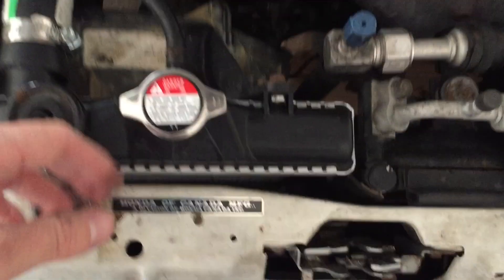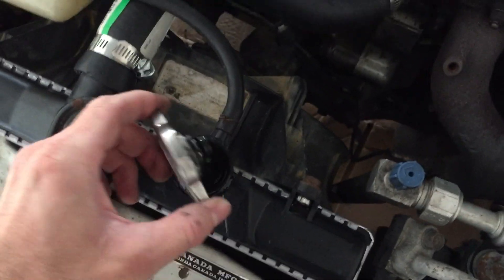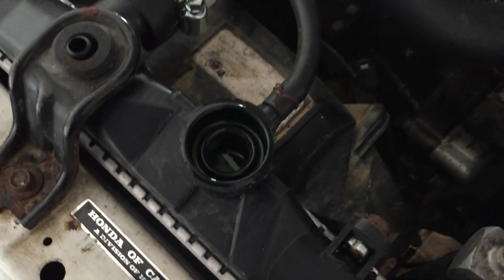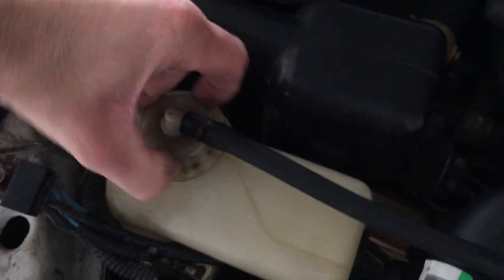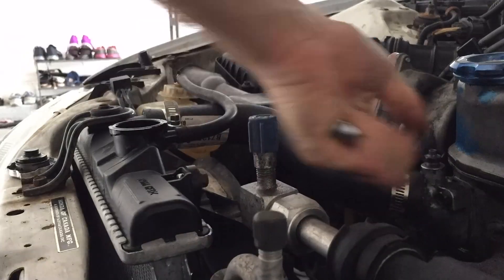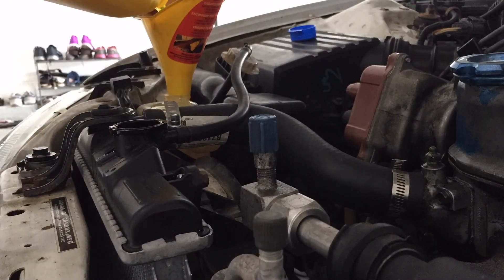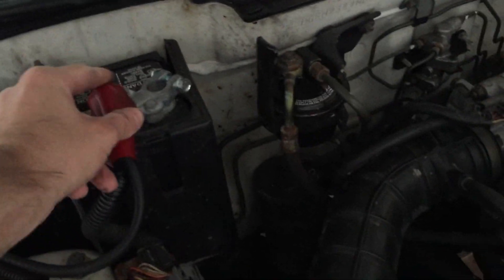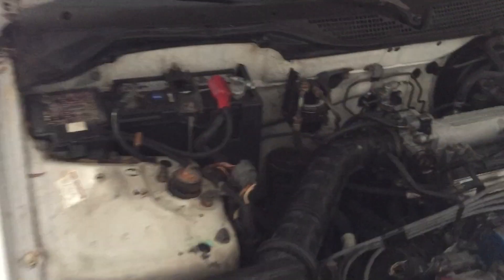Okay, the battery's just connected and I'm going to check the coolant level, because the fan has turned on and the engine has cycled. It looks like it's still pretty much at the top — maybe a little low, so I'll add a little bit and check the reserve. That looks to be definitely down, so I'll put a little more in. Coolant is all topped off, reservoir topped off, bleeder valve closed. I'm going to put the battery back on, tighten that down, and then we're going to go.